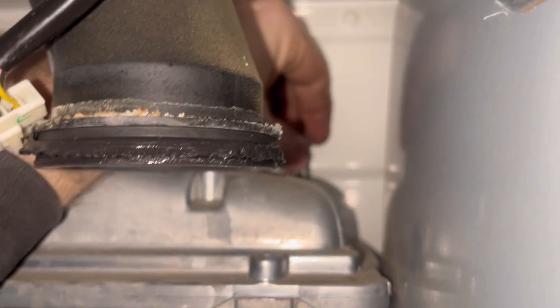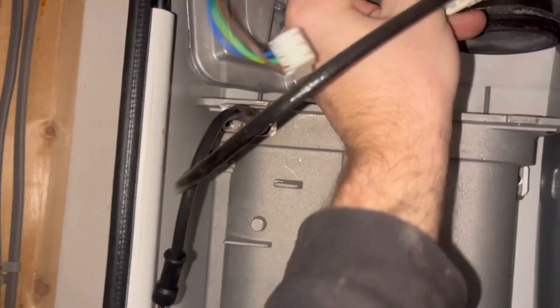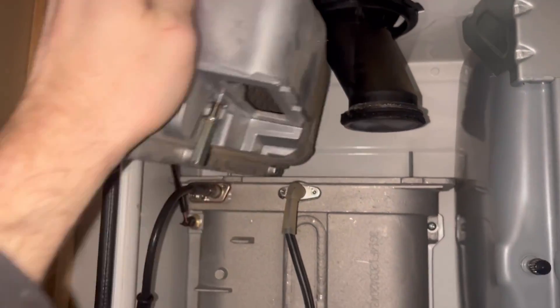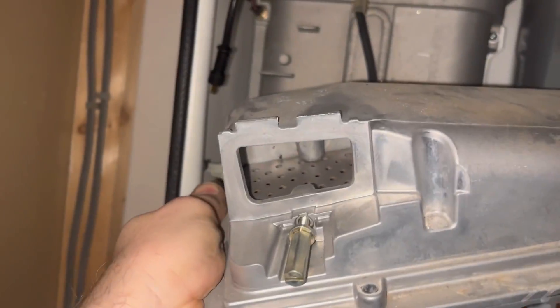Just get this one out at the back. There is a knack to getting these burners out — what you want to do is lift it, pull it on its end like that, then turn it to the side like that. The same technique applies when going back in. That doesn't look too bad — we'll check the plate in there as well.